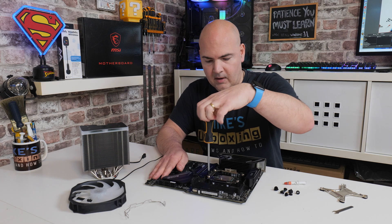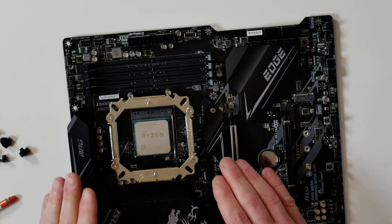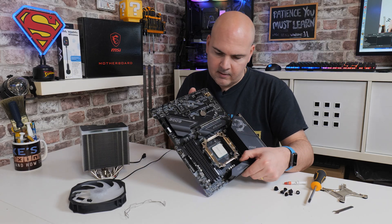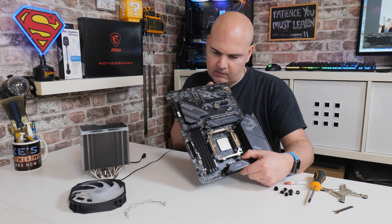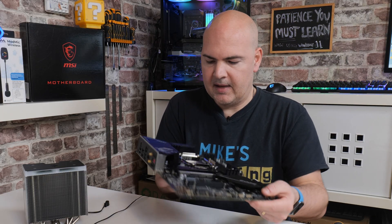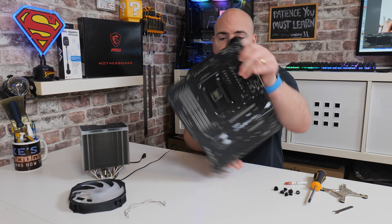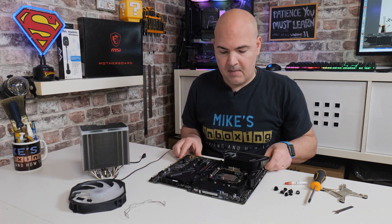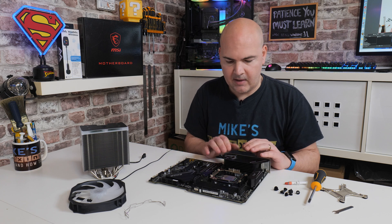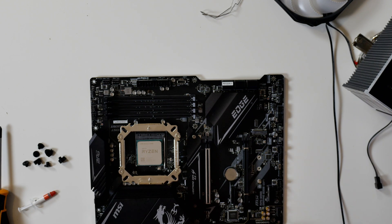It's pushed down a little bit more so we've got more to screw down — now it should be completely flat. At this point, do a quick visual inspection to make sure the gaps are the same all the way around. You can check the angle against a PCI slot just to make sure it is sitting absolutely flat. That is probably the most difficult part — making sure the back plate and the top plate actually match up. You may need to maneuver a little bit to make it sit completely flush. So let's now get the cooler and the fan ready to be installed.